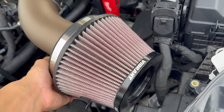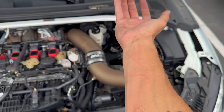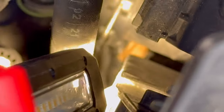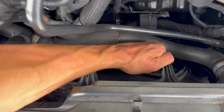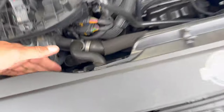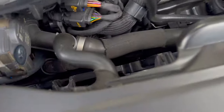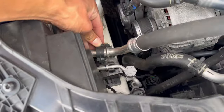We're going to raise the filter up about half an inch since the intake is hitting on that nub. After some bruised arms and tight spaces we finally got it. You can see my little piece of cardboard shoved in there — the whole thing does not move at all. Shake test: no movement whatsoever. That stuff's in there tight. I also moved the intake up ever so slightly and it's no longer hitting on that little nub. At least for loose things, we'll keep checking around. I think we're good.